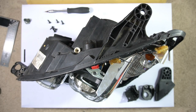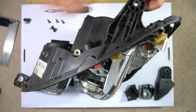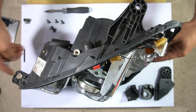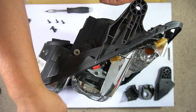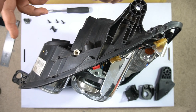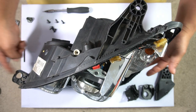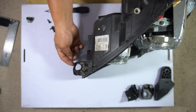That way it will actually screw the new mount onto your broken mount. On this headlight — the left-hand side — I don't have to replace the top one, but I do need to replace the one on the side and also this one here, as you can see it's a little bit mangled. I want to show you how to replace these two, and then I'll show you how to replace the top one on my right-hand side headlight, because the top mount on my right-hand side headlight is the one that's broken.